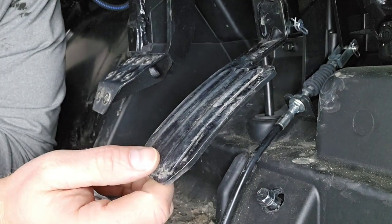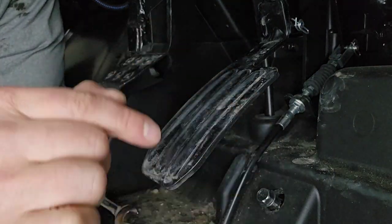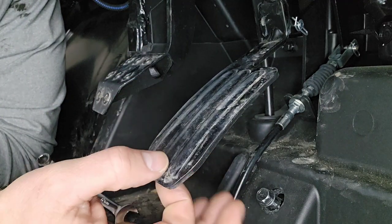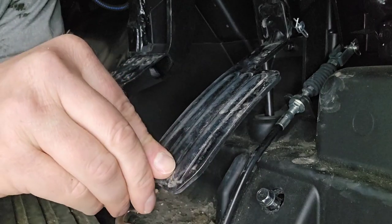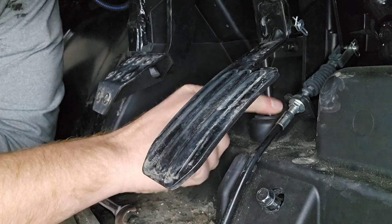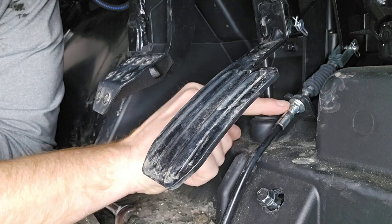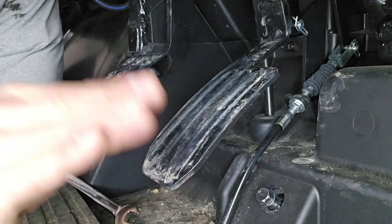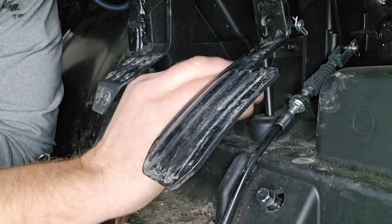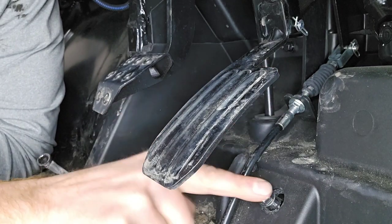You don't want it so tight that you're getting more engine RPM at idle — that's not great. You want this zeroed out so your engine idle speed is just idle. I have just this little bit of play, and then when I press on it we're going right away. So loosen these up, back the top one out as far as you can, then tighten the lower one, watching that play, and then lock the top one down on it.